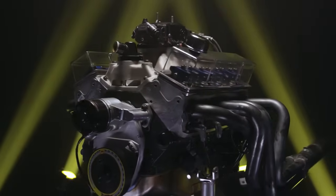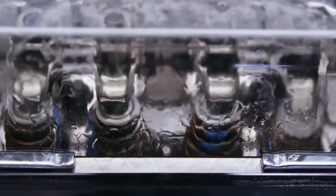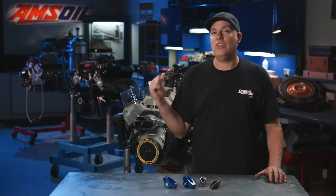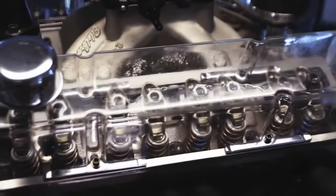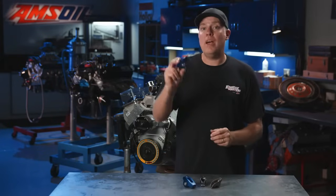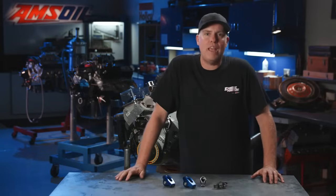The engine I chose runs to 7,000 RPM, and the reason for that is if we're going to see any improvements from frictional loss in any of these rocker arms, we're going to see it at higher RPM. If we don't see any improvement at higher RPM, you can fairly conclude it's not going to have any effect on an engine that only runs 5,800 or 6,000. The engine is a 372 cubic inch small block Chevy with a single plane intake manifold and big AFR 195 heads. We're going to start with the stock-type stamped steel unit, bolt them on, roll it into the dyno, fill it with some AMSOIL, and fire it up.